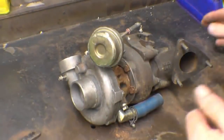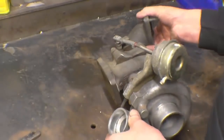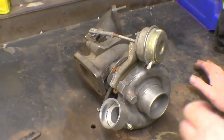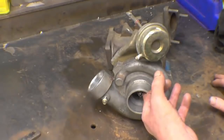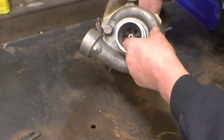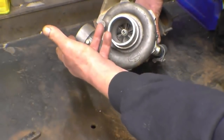This is going to be the basis of our jet engine — a second-hand turbocharger that hasn't done much work. It was used on some sort of development jig. I'll go through the parts so you know what they are. We'll start at the beginning: that's the inducer, that's where the air goes in. Inside there is a compressor fan that compresses the air and blows it out — air in, spins around, compressed air out into our engine.